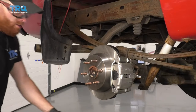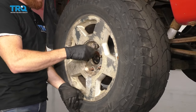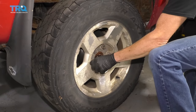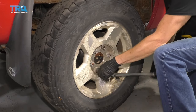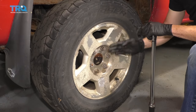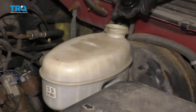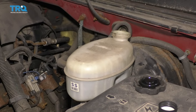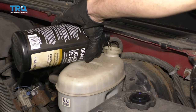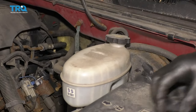Now it's going to be time to get the wheel up on here. Let's start on those lug nuts and then we'll bottom them out and torque them to 140 foot-pounds. Double-check them if you want, and if you have a center cover, put that on as well. Let's make sure we double-check that brake fluid — give it a wiggle. It looks as though this is low; there's the maximum line. Open this up and we're going to add some DOT 3 brake fluid. Bring it right up to that maximum line. Make sure you close it back up. Down the road you go.